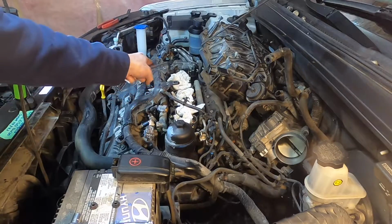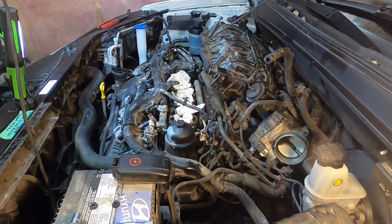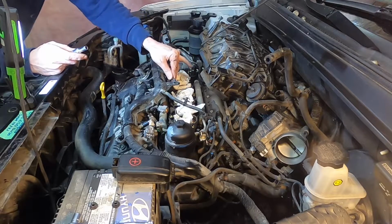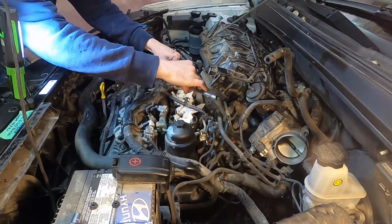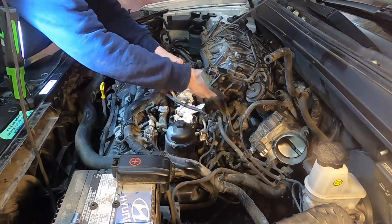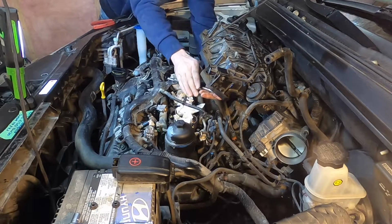Okay, so those Allen keys down in there, they are 6mm, and if you have the socket style Allen keys, they don't actually fit in there. It's a really tight space, so what you need is one of these traditional styled ones, and you put the long part down in there, and it fits to right there. Get it turned right so you can get whatever size socket will fit over the end of the Allen key, and a little extension to give you some leverage. Make sure you hold down firmly on it. Really firmly, and apparently it requires quite a good pull on there.